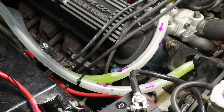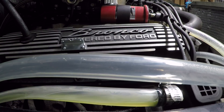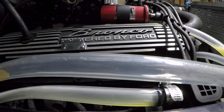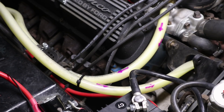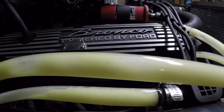With my engine getting up to temperature, you can see the warm coolant beginning to fill up the heater hose, but it stops right before that temperature control valve. Now, before you get on me for having air in my coolant system — I purposefully didn't bleed the system so that it would have more of a dramatic visual effect showing the coolant flowing through the system. Now as I open the temperature control valve, you can see the coolant moving into the heater core. Watch as I step on the throttle — you can see how the coolant flows through the heater hoses and circulates through the system. It looks pretty cool having the coolant flow through the clear tubing, but this tubing isn't rated for 212 degrees — it's rated for about 170 — so this is not safe to drive. This is for visual purposes only.